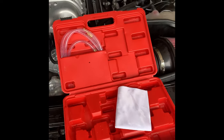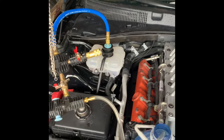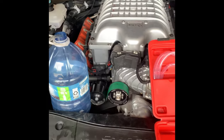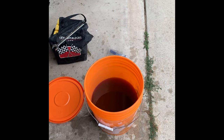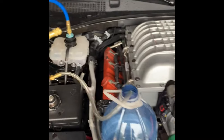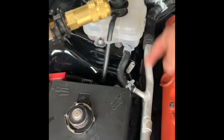So today I went out and picked myself up this little vacuum here. This is going to help me fill my tank completely full — it's going to pull vacuum, pull all that air out, and then we're going to suck the pre-made coolant back into the system.